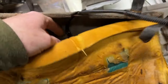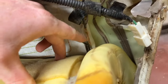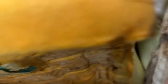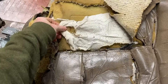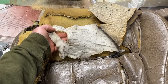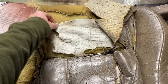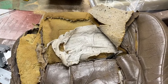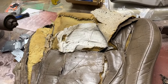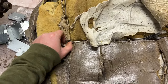We're gonna trace this wire and figure out where it goes — I'm assuming it's the heater, and yep, there it is. We'll have a rod going through there with hog rings attached. We need to cut those to pull them through. That's pretty compromised. Like I thought, that's the heater — the wires are cut on it and everything. Doesn't look like we're gonna be able to reuse this one. That is very unfortunate — looks like my tail is gonna be untoasted. Good to know though — maybe I can order a passenger side heater and put it in so my wife will be nice and warm when she rides in the 4Runner.